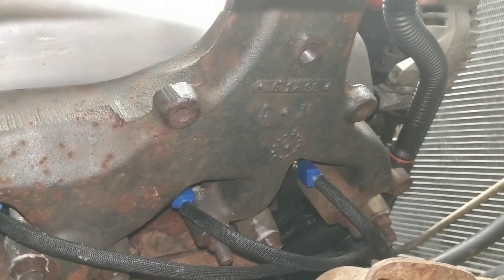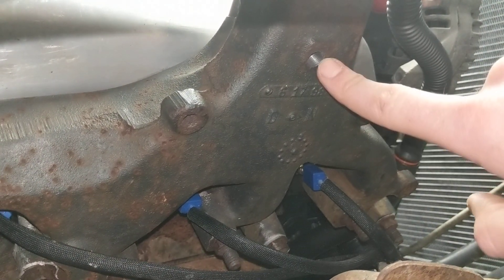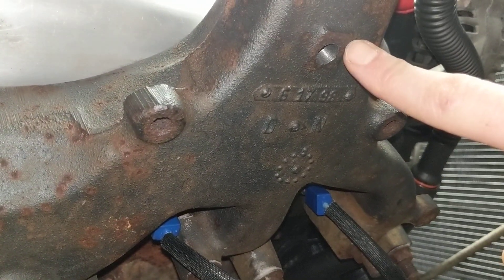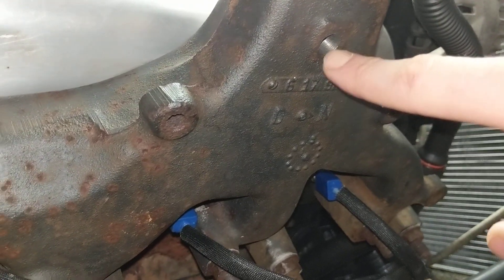The reason you want a specific bit size is so that the tap can cut correctly. You want to drill kind of perpendicular to the plane — this is the thicker boss. We'll zoom in a little bit here. Hold your drill bit perpendicular. You want to drill a pilot hole first and then step up to the 21/64.